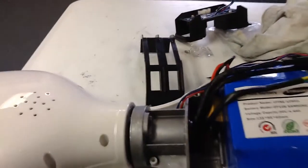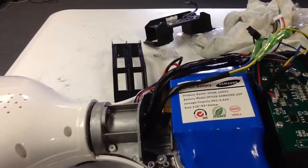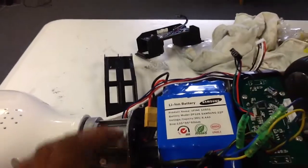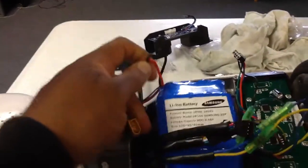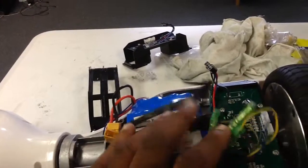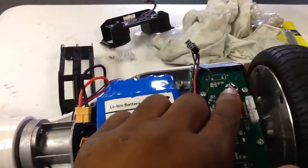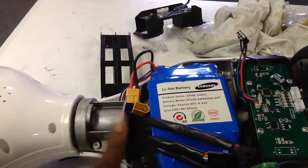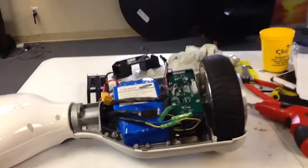Now you have seen the different types of variations of batteries for hoverboards. That will conclude the video for this particular lesson, but always remember when you are doing anything to your hoverboard to disconnect the hoverboard from the battery before doing anything and begin working on what you need to work on. Also keep in mind that even though you disconnect the battery, these capacitors right here — this is a posture sensor — there is still power stored in them, so you still have to be careful and make sure you don't arc out and ground out anything on the metal. And you should be fine. This concludes the video on hoverboard batteries from Computer Side Electronics.